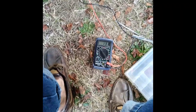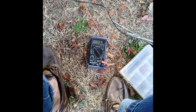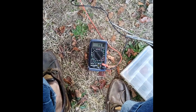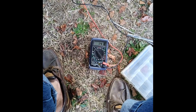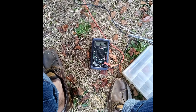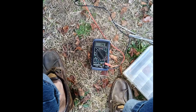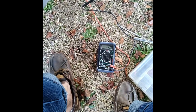We're going to check the charging system now. Just started it, it's cold — only reading 13.2 volts. Throttle it off a little bit and it rolled up to 14.3, now showing 14.4 volts.